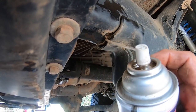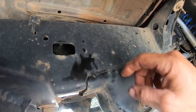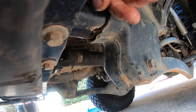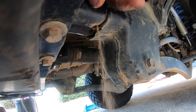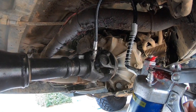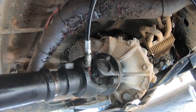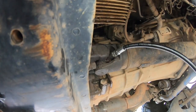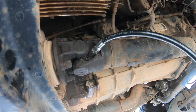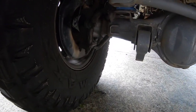I might have to do a bit of a chassis clean — I just saw a bit of mud pushed into the chassis rail. It's good to clean the chassis rails out anytime you're under here with the creeper. I'll get the grease gun out and put a bit of grease in all the unis and the slip joins. I think I'm going to take the kids for a bit of a wheel tomorrow — while you've got the grease gun out, anything else that needs greasing, especially the tie rod ends.